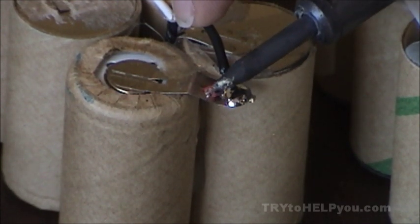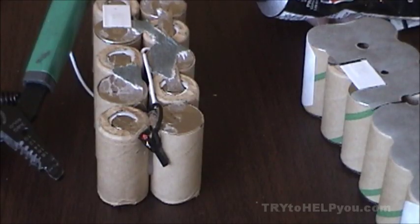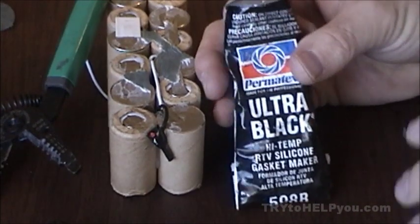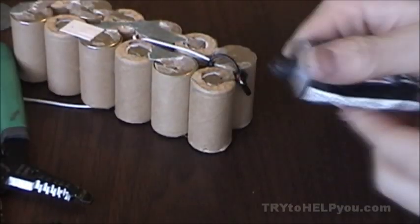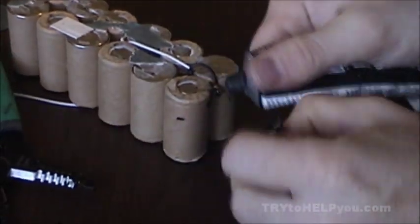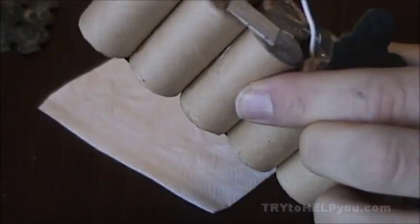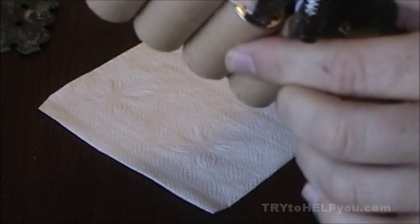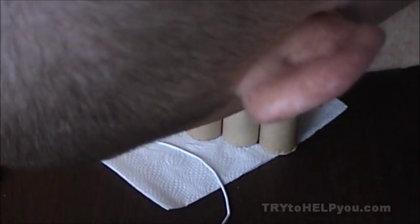Do not do the soldering step before taking the nickel plate off, or else the battery is going to get really hot and perhaps crack open and start melting all over the place or even explode. You have to take that nickel plate off before you do this step. Once that's all said and done, you can cap it off with either shrink wrap or some silicone — I used silicone and it got messy, so wear gloves if you've got them. There's also a white wire which I believe is for heat sensing; shorten that up and cap it off with silicone too.